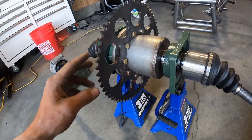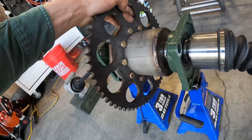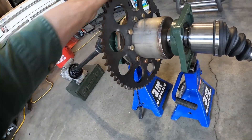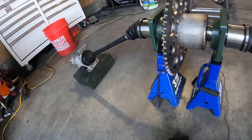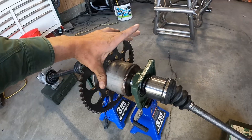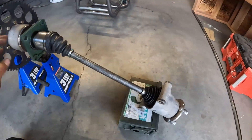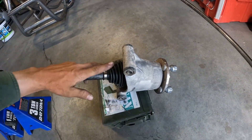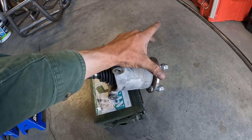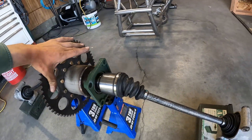The sprocket is going to be custom cut. You're going to custom cut it and then once you get it, you're going to slice it down the middle and make a split sprocket so you can fit it around this. I didn't design a brake for this up here because the buggy I was making it for — I'm going to be making my own hubs. I'm going to add steel and have my brakes down there because I want to have really good brakes. So the buggy I built this for doesn't have a brake up here, that's why I didn't design it there.